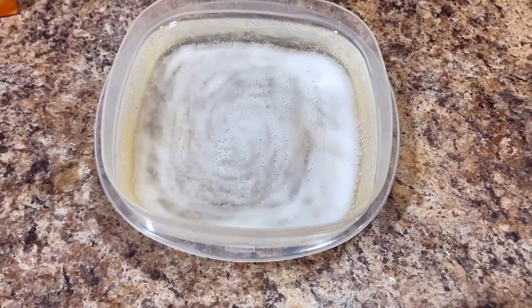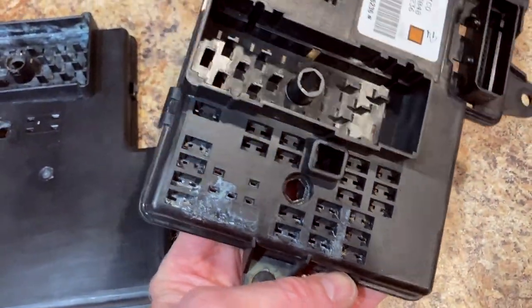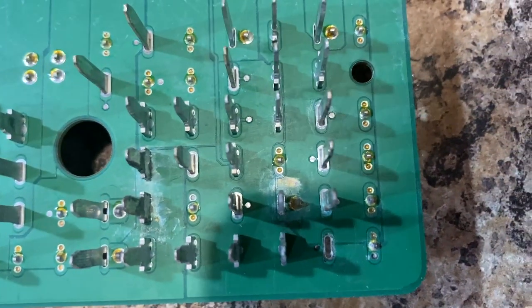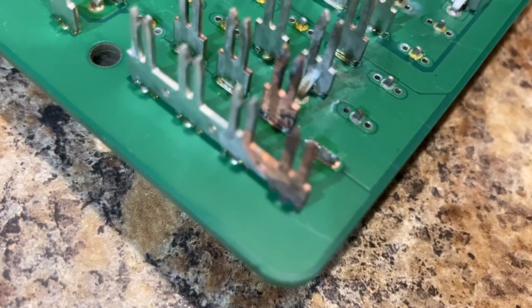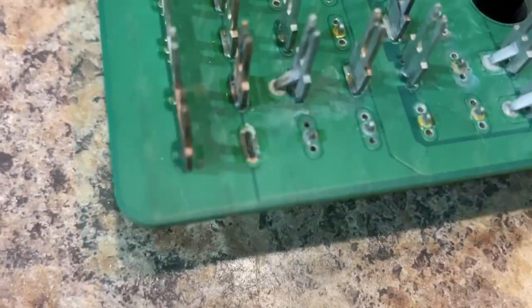15 minutes is almost up. Once it is, we'll put it over here in this baking soda and water solution to neutralize the acid, then wash it all with distilled water. Then we'll let it dry for about two days. Here we have it all de-corroded. You can see there's still some discoloration on the actual board, but all the corrosion is gone off the terminals on both sides. You can see that copper color on those terminals — the corrosion was eating away the silver coating and the copper underneath is showing. And there's our hole that we've got to fill with our pin once we get it.